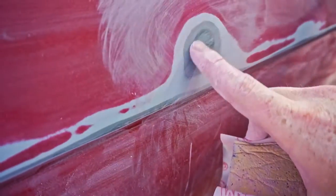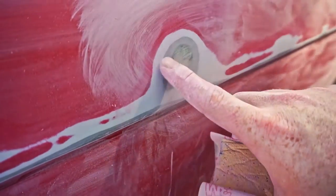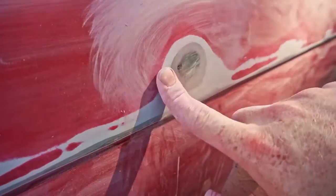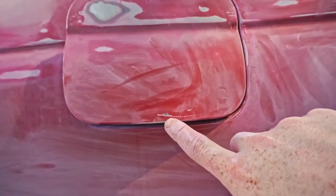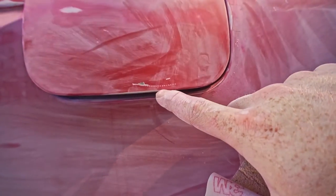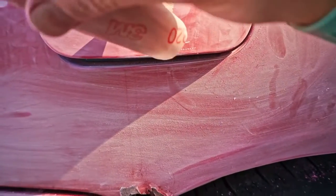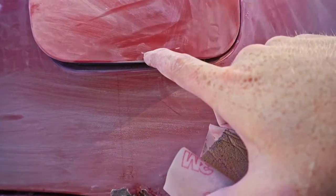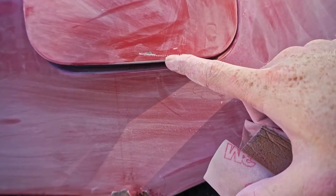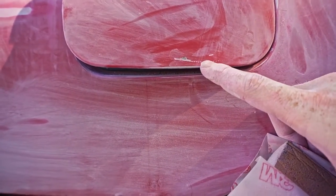Now I'm all the way down to the bare metal — the chip had started to rust, that's why it's off color, but it is smooth. I'm going to go ahead and paint over that. Down here you can see a chunked-out line from my palm sander — I came in at an angle and it chunk-chunk-chunked the paint all the way down through the primer and sealer to bare metal. So be really careful with your palm sander. If it does happen, just sand all the way through down to the metal and you'll be all right.